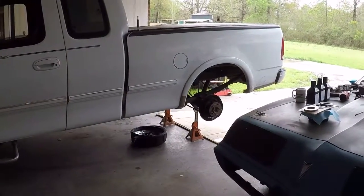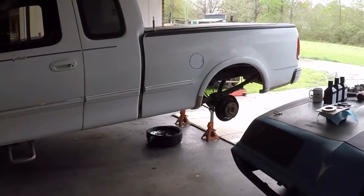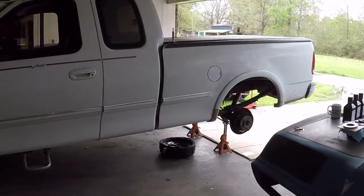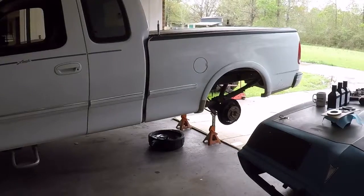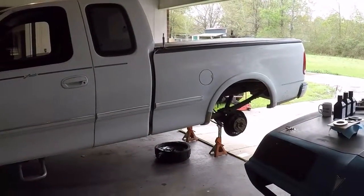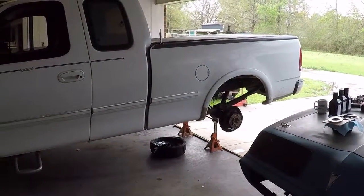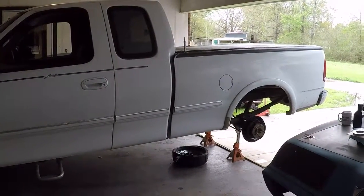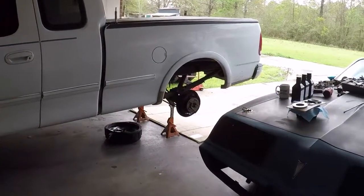I mean, it's got replacement springs in the back, the four-wheel drive motor, one of the four-wheel drive solenoids. The transfer case is all original, but the thing that shifts failed. They do. A lot of the shocks, bushings, A-arms, wear parts. I just replaced the steering box a couple of weeks ago. The Pitman arm was junk, so little ball joints, things like that, but nothing seriously mechanical. And the truck shows no signs of slowing down.